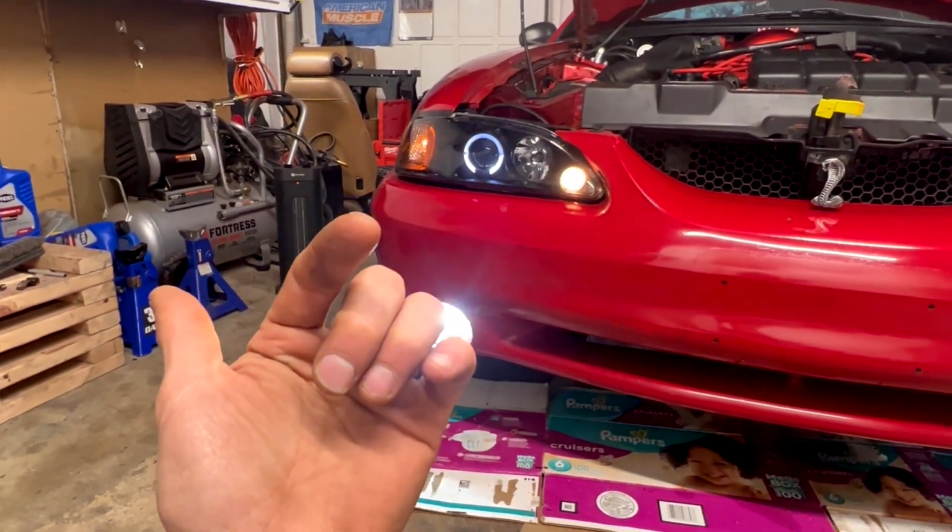So up where you put your bolts in, it'll be easier if I actually show you, but up at the top of the bracket here, I know it's dark, I noticed that if I pushed on the bottom, it sat in there exactly where I wanted it. So up at the top here, I loosened up the bolts just a little bit, and then I took some 1/4 inch washers and I stacked 3 of them on top of each other, then wrapped them in black tape and pushed on the bottom edge, and then jammed them washers down in there as a shim to hold it forward, and then just tightened the bolts back down so that it keeps it at that angle. And as you can see, it makes it fill out the housing really well.